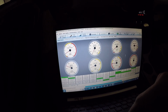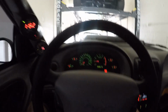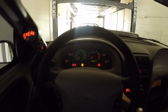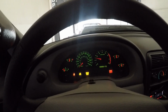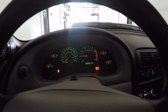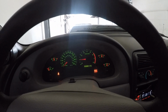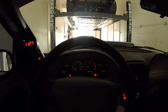I think we're good. Now I like to see if it'll crank up and start at warm start. Car off. Turn the key again. Okay, we're gonna start it without giving it throttle. I have it set to where it idles up pretty high for a second. I need to adjust that, but I'm not too worried about it right now. Didn't have to give it gas, idled up, started. Let's make sure it just drops back down and idles for a second. Give it like 30 seconds. I'm happy with those changes for the day.